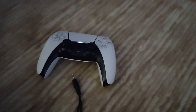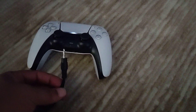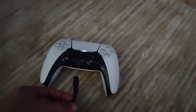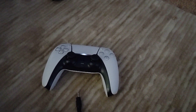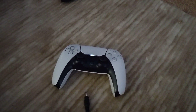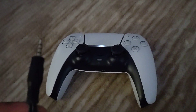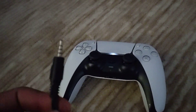One of the ways to do it was to plug a headphone jack into the controller to force the PS5 to output the audio out of the TV. It seems like it's a bug because the settings already have HDMI device in there, but if you select it with nothing else there, no audio comes out. We found out that just plugging in the headset jack — you don't need anything at the end — and it will go out.